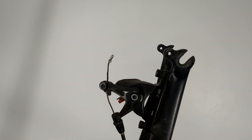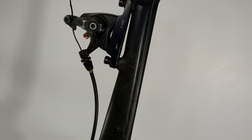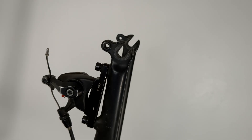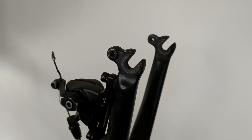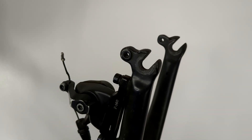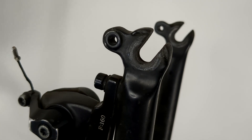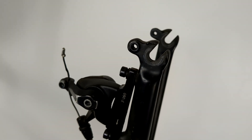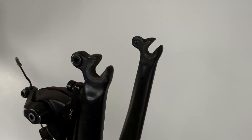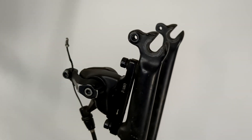Basically they're using 9mm axles now, whereas on Yossi Power it still looks to be an issue. I've not got a file so I've just ordered some — diamond files off eBay, they're really cheap and about 10mm width. I'm going to file the dropouts, and I really don't want to but I think I'll have to. These are carbon as well.